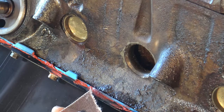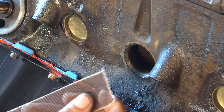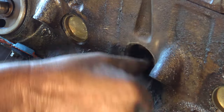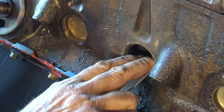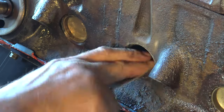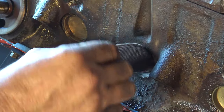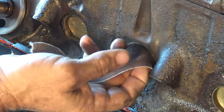After I removed the freeze plug, I noticed a little bit of residue left over from the old one, which I should have expected. So I'm going to take a piece of open mesh sand cloth — regular sand cloth will work — and just get rid of that old stuff and make a nice surface for the new plug to seat into.